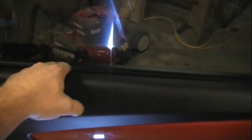Okay, the bolt that comes out of there, it's a 7mm bolt that goes in there. Of course, that is the Torx head. Then you have the 3 that you took off. Now everything is clips. But you're gonna want, there's 6 clips here, and on the weather stripping here, there's 6 clips to pull straight away from it. Be careful with the weather stripping.